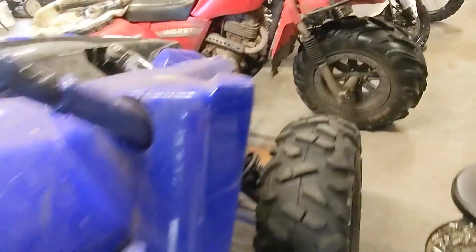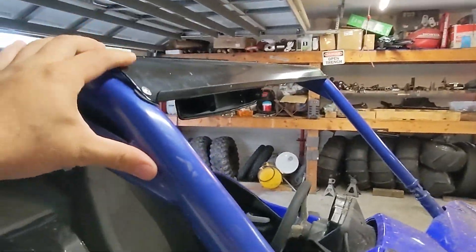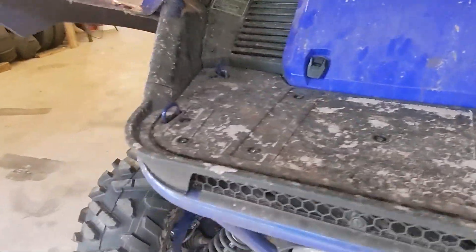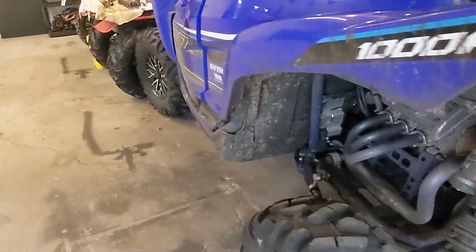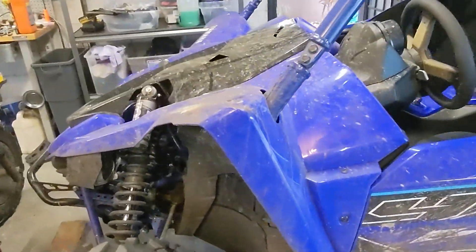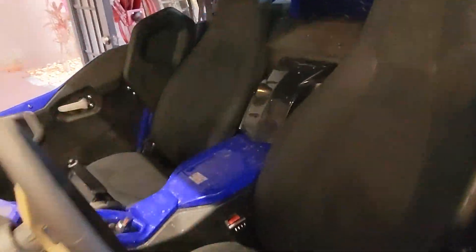But it did good at Holopaw. Finally started to open it up and use wide-open throttle. I think that's the only one that's cracked. It did good — the roof made a little bit of vibration but we took care of that. This thing's definitely fun. Can't wait for the tune — I do feel like it's running a little bit lean. Also, totally fixed the throttle hang issue by tearing it down and adjusting the butterfly, so that's good to go.